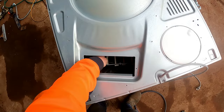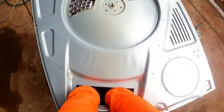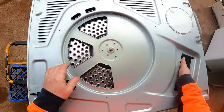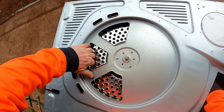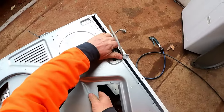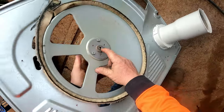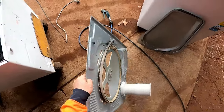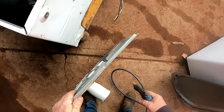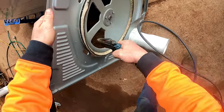You can try doing this motor capacitor through here but you can't fit two hands in, so it's much easier to take the back off. Hold your drum up, put your fingers in here, slide it off your main shaft, then pull it up and take your cord off - it's that simple. Your bearing - if you want to replace it, give it a good check to see if it's going to wobble. If it doesn't wobble she's all good. Give that a dust off as you go - watch your filter there, the liner rubs on the drum.